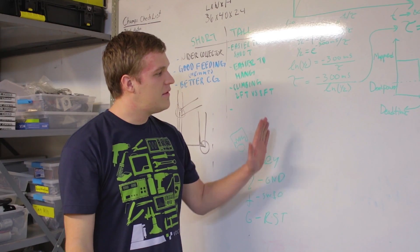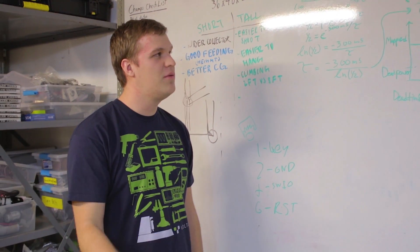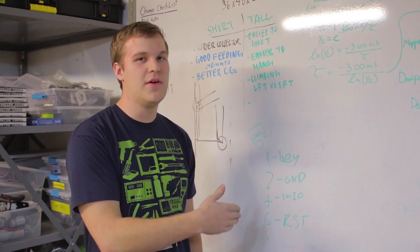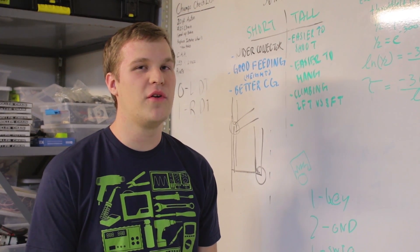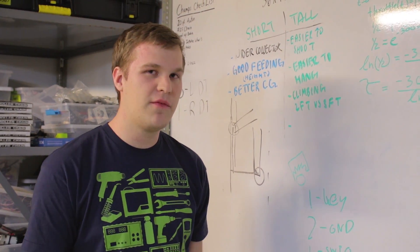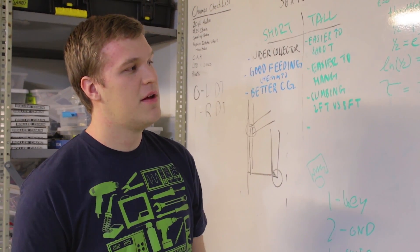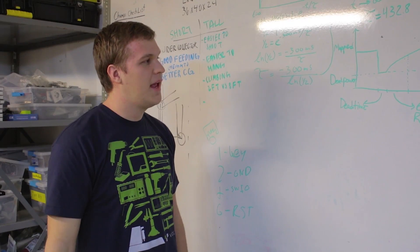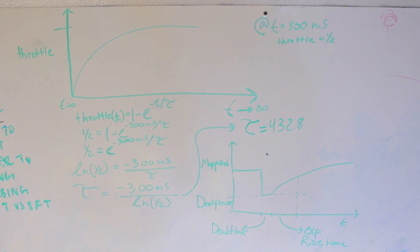To detect when we need to go from low to high, we have an RPM sensor that we can map to feet per second, with thresholds for when we should shift in each direction. From our first test, we found we need to take an approach similar to driving a manual car — you wouldn't put your foot down while the clutch is in. So we're going to have a little dead time, which allows for the dog gear to catch up, and also apply an exponential decay map on the throttle.